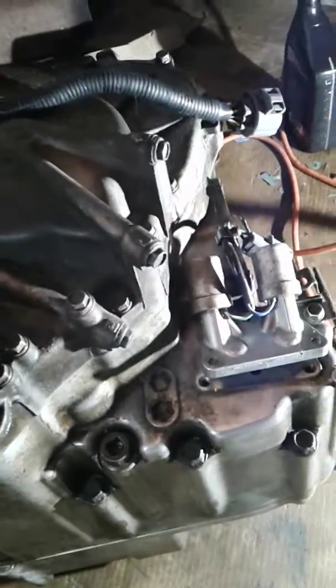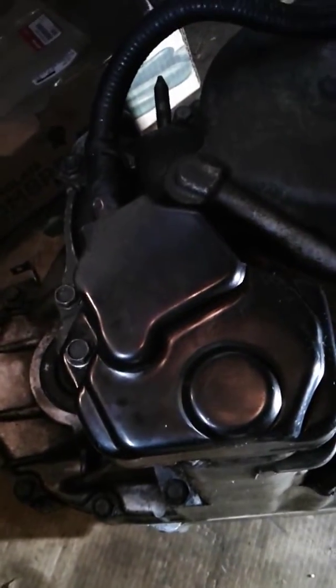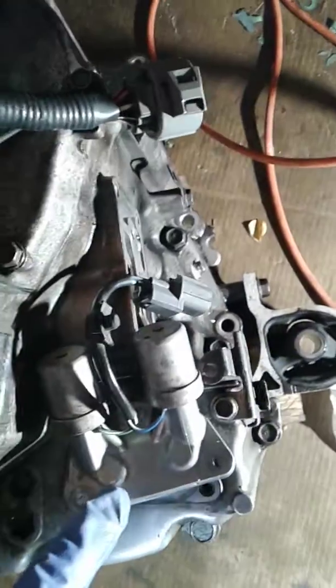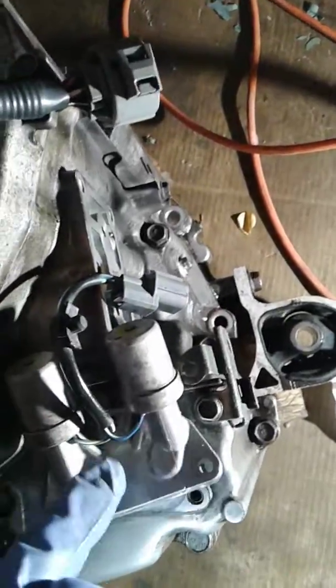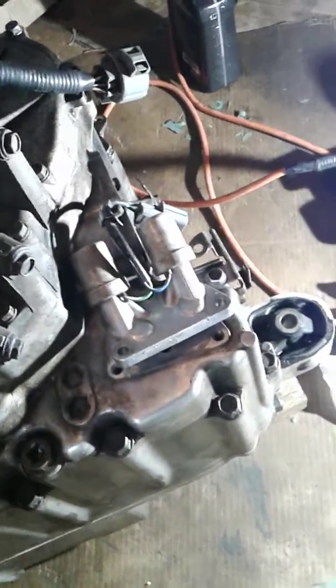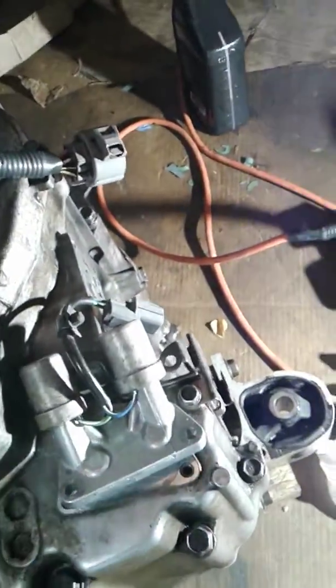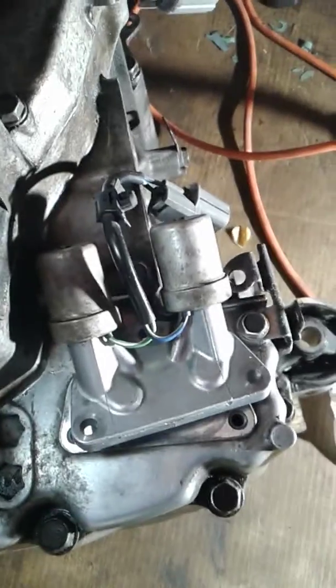This is part two of the sensors rebuild. Except for the range sensor, I didn't have to replace that. It's this piece, the dual shift solenoid and the linear solenoid, there are no problems with it. I've already tested this. But since I'm here, I might as well replace this unit, because this is the unit that usually will go. If it's an 01, so 2019 to 01, that's 19 years, so it's time to replace this unit, because I don't want to go back in and squeeze it in just to get three bolts out and get a new part in. Since I'm here, I may as well replace it now. So it's additional cost, but it's well worth it.